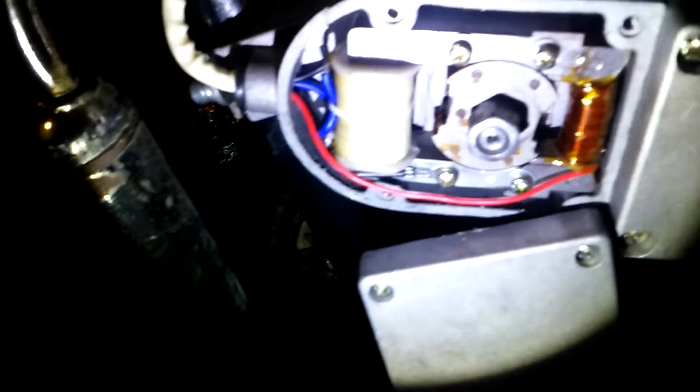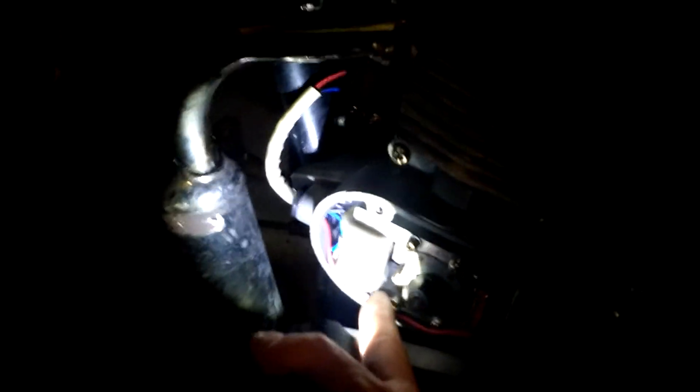We're not dealing with big power. Okay, we have our red wire coming from our generator — and you see that black wire there, this one right here? This is my secondary ground. That's it — it's my secondary ground, just for my electrics. It runs nothing else but my electrics. So my hot wire and my ground wire here grounds the whole electrical system.